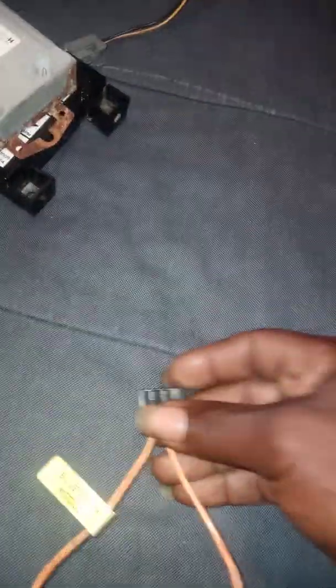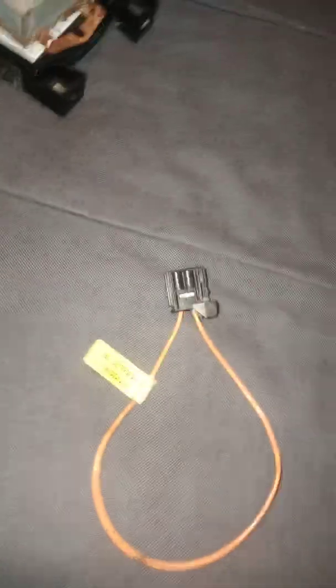Once you get back to your car, under your seat, the one that the light is blinking on — which will be the black plug like this — what you pull this out of will be a black plug. Stick this in here, put that in your black plug just like this. However your plug is, put the plug in — radio fixed. You will have no more flickering screen. That's the optical bypass.